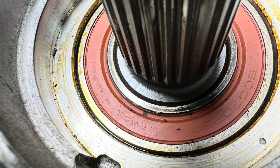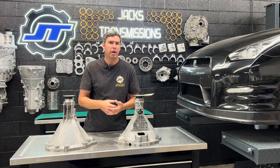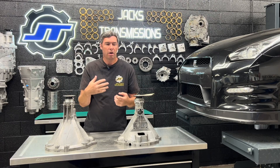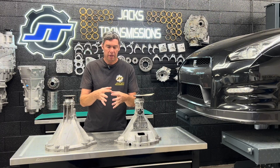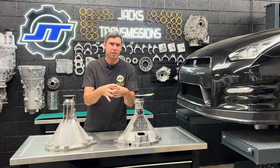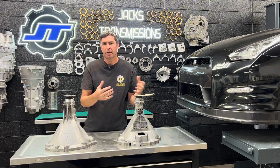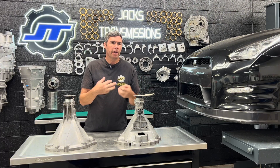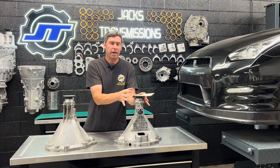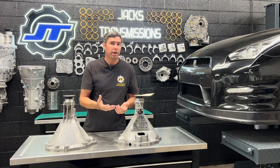On the CBA, the bearing is pressed directly into the housing — the bearing is on the aluminum housing. In time, just due to abusive engine harmonics, which is common in automotive applications, just driving the car, the environment, the area where the outer bearing race mates to the case begins to compress and wear out due to movement and impact on the case. After some time it'll get loose. This will be able to move back and forth in the housing, and you'll get some knocking noises out of the bell housing, and you also get a vibration.